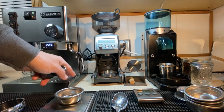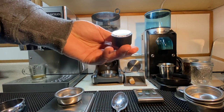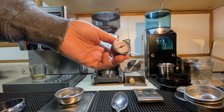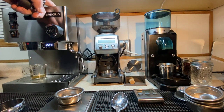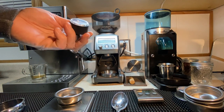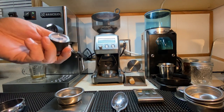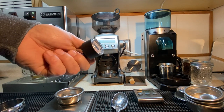The Silvia came at 12 bar out of the box, which — if you're new or old to espresso — you know that's not recommended. It's a little higher than what you'd want. I was able to turn it down inside. I have a video on that where I turned the OPV valve down to get your bar pressure down. I'm currently using it around 8, which is a bit under the recommended 9.